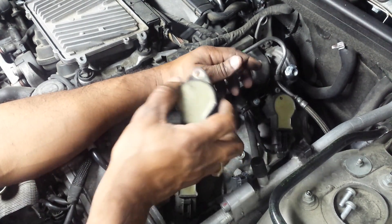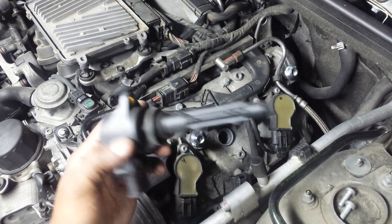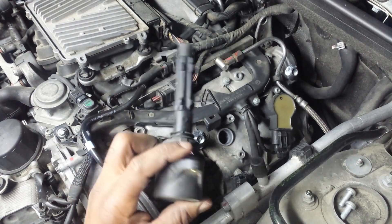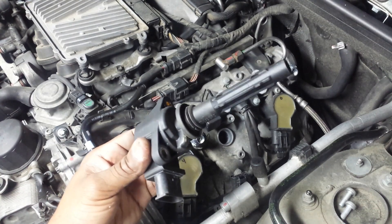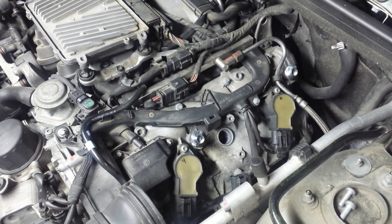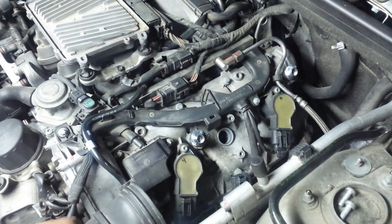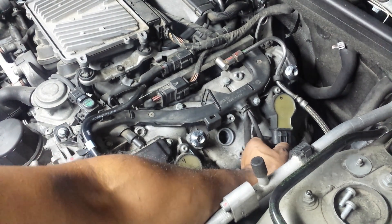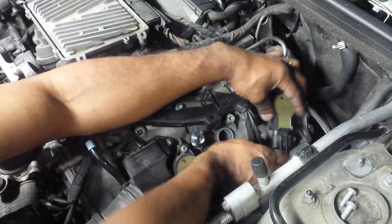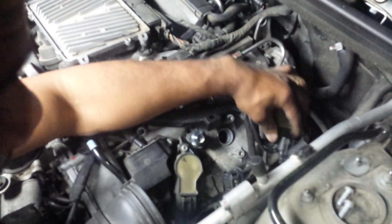I'll do that shortly, but this comes off pretty easily — just press this button to disconnect the electrical and you unplug it. This is a coil pack for the vehicle, and it's saying that both five and six are bad. I'm going to test these and I'll probably create another video showing you how to test them, but I won't do that in this video. I'll put a link showing you how to test it. That's cylinder five. Now I'm going to do cylinder six, and before I loosen this one up completely I'm going to disconnect the electrical on this one. Pay close attention to which one you removed it from so that when you reconnect it you don't connect them out of order.